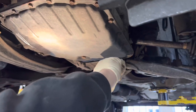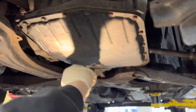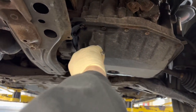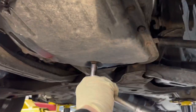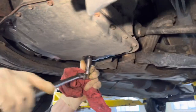I'm going to get the pan and drain it. We'll tell you the size of the pan plug — looks like either a 13 or 14. Battery just died on the light, we got another one. I'm just going to crack these all loose and then we'll come back in just a moment. So we've got a 14 millimeter drain plug.